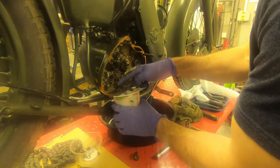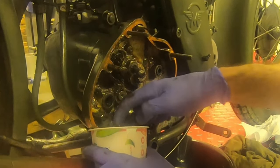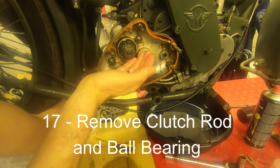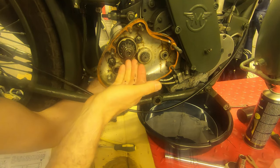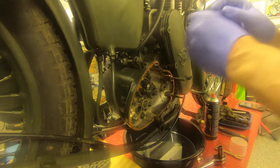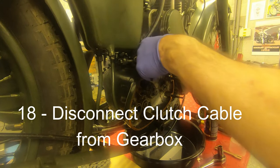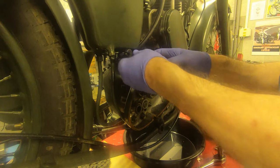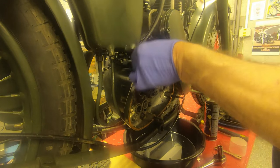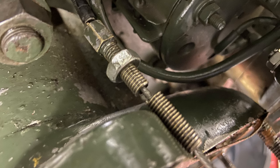Now it's time to get the excess grease out and clean up the gearbox a bit. The rod that actuates the clutch goes through the middle of the main shaft — when I push it from the other side of the bike I'm expecting one ball bearing to drop out, but in fact my bike's got two. Another surprise awaits when I undo the clutch adjuster which screws into the back of the gearbox shell. As I work it loose I can see that the adjuster has actually snapped in half — that explains why I couldn't get much adjustment earlier. Time to order a new one; unfortunately you have to order the whole thing with the cable as well.